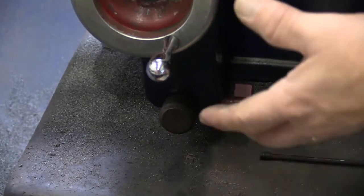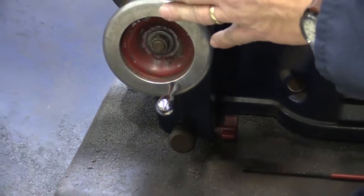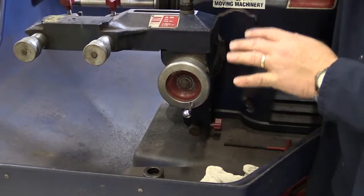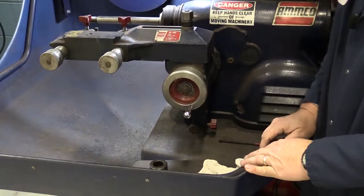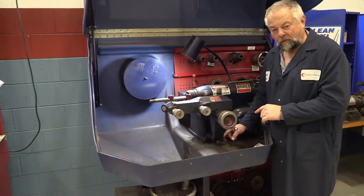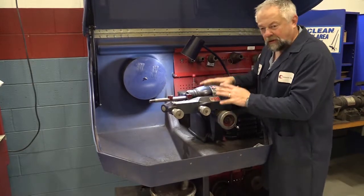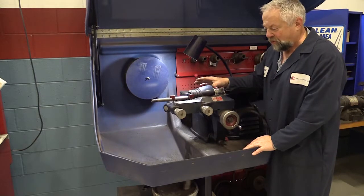Once we replace that, we'll get rid of that rocking, because when that cutting head moves, that's going to chatter — and I don't care how many silencer bands we put on that rotor, we're going to get chatter marks on that rotor as we're machining it. So we're going to go ahead and replace that bushing and spring, put it all back together and check it again. I've put a new bushing and spring in the assembly, and as you can see, there's no play in the cutting head any longer, so now we can get a nice smooth finish on that rotor when we're machining it.